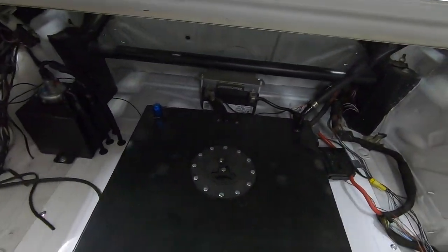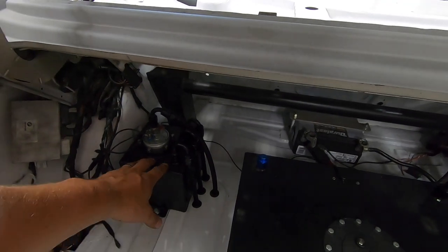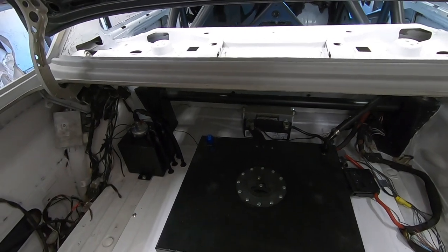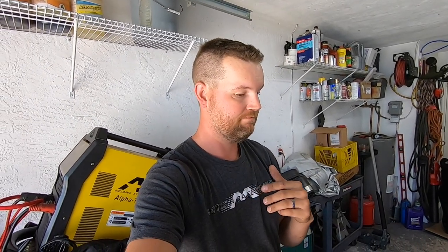The gearing is a little tall but I'm going to keep driving it and see how it feels once we get on a real road course. I have very limited seat time right now. It's a 15-gallon aluminum fuel cell with a swirl pot, running a Bosch 044 pump, and a cheap lifter pump from the bottom of the fuel cell to the swirl pot. Also running a motorcycle battery, and the whole chassis harness and drivetrain essentially doesn't know it's an E30.